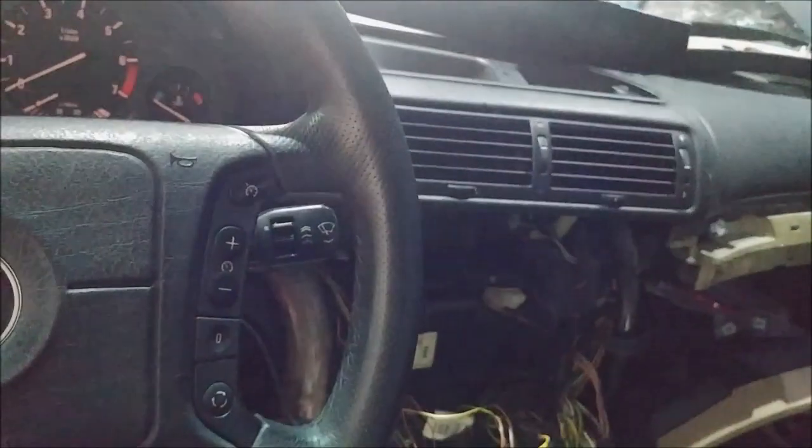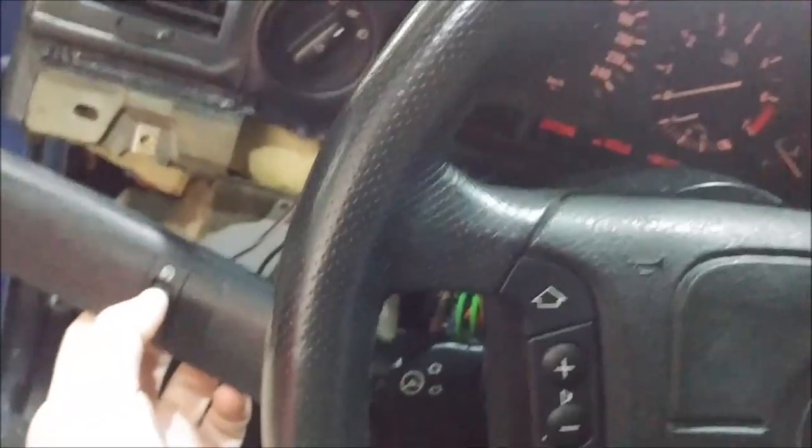Sorry about the lighting conditions in here. So here's what I've done. Again, the brightness. I'm dimming it, light it dim. No brightness there, because what I've done is I've gone to the CAN bus box, this guy here, and above that red wire was illumination in, and beside the pink wire was illumination out, which went down to the harness into the main unit. What I've done now is I've bypassed basically illumination.